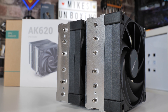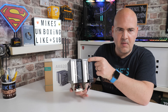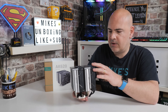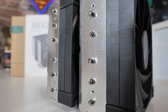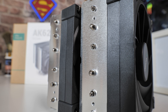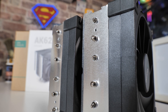Going back to what I said about reducing height — if you look at the side, that top section takes up a few millimetres. So if you remove those covers, you can lower the fans down slightly and gain an extra couple of millimetres. Obviously, you do have heat pipes coming through the top as well, so take that into consideration. You aren't going to magically get an extra five or six millimetres — it's probably going to be two or three after accounting for the heat pipes and manufacturing tolerances.